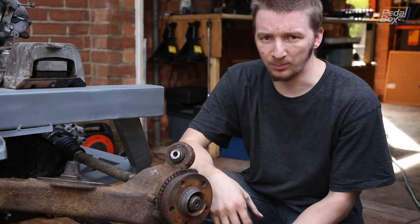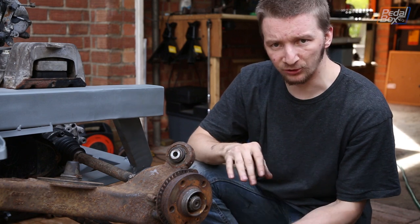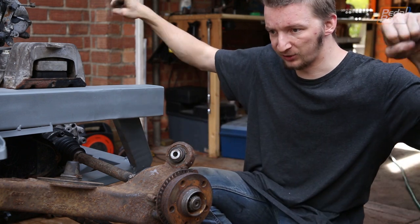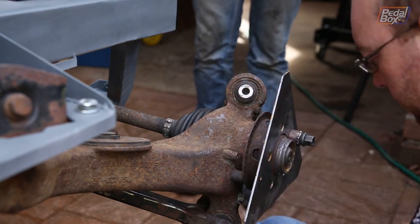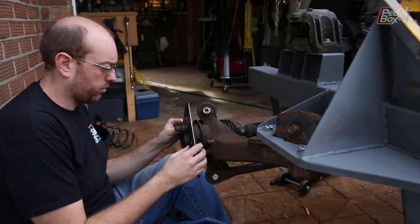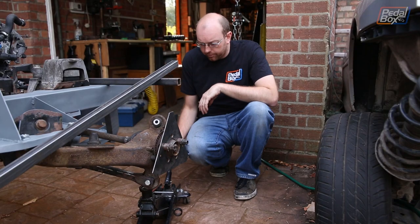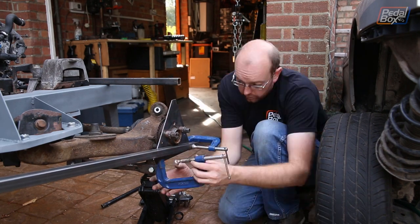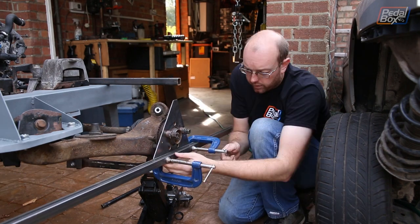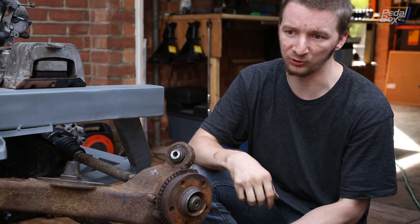The jig we're building is pretty simple — a lot nicer than the engine frame jig we did a few episodes ago. We're putting a big cross member over the back of the chassis; it's not going to bolt down or weld on, it just sits there. From that we put little hangers that come down and grab the hubs — plates on the hubs aligned for toe and camber — then weld those up to the cross member and hang the whole thing on the back of the car to set the hubs in place.